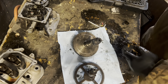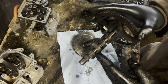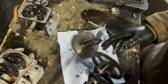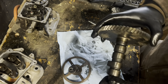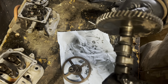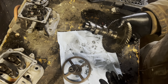Here's another thing I definitely want to point out: this Briggs cam has lobes that can be moved on the shaft — these are not one piece. You could theoretically turn it into a racing cam and advance the lobe a little bit. But you look at the Kohler — it's one milled piece. They took the time to mount this to a lathe and turn it with sanders, perfectly timed to get the exact lift point. And that's just a cam. Kohler wins that battle hands down.